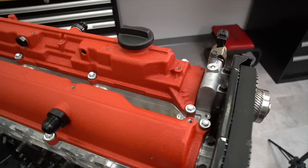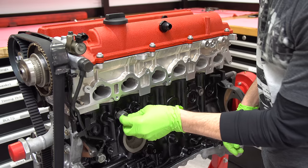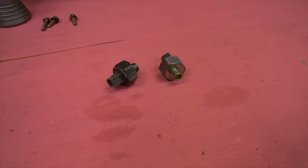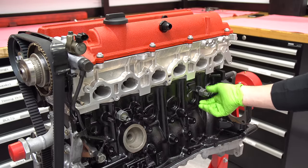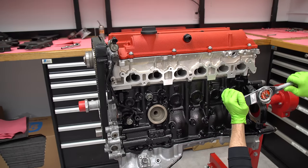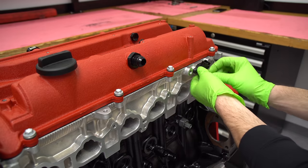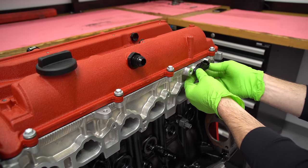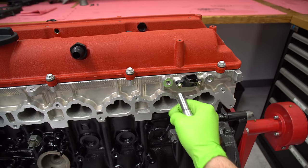You can also see where we added the AN fittings to the valve covers for the crankcase breathing system. We're actually going to utilize both of the knock sensors on the engine, and this is another area you have to watch out for. I masked off that area when I painted the block because I want to make sure that the knock sensor is directly on the actual metal block, and making sure that we torque it correctly — because depending on the torque, the knock sensor will actually output a different strength signal. Next we've got the cam sync sensor — this sensor tells the computer where the intake cam is in relation to the crankshaft.